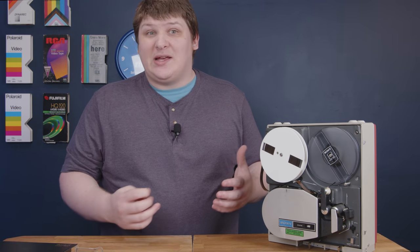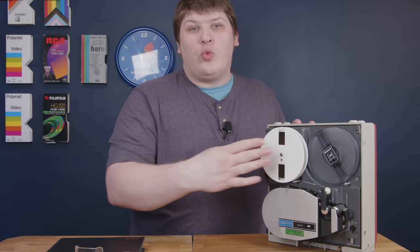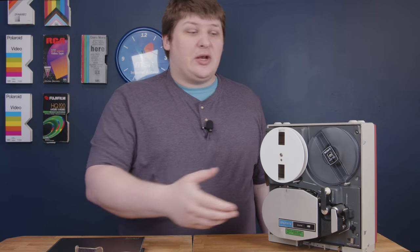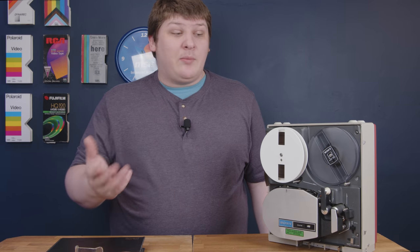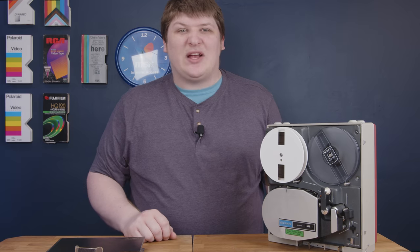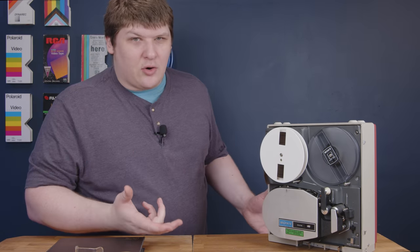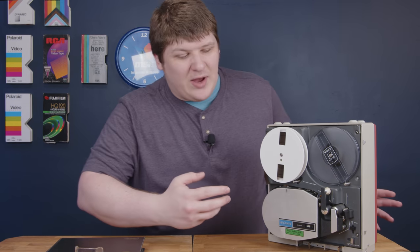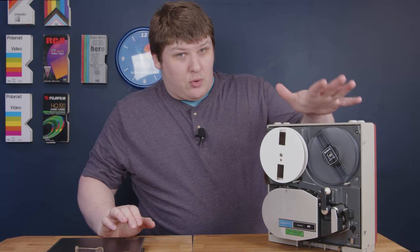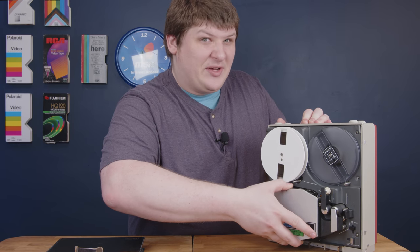This video recorder has similarities but also some really big differences. Instead of quarter-inch tape, this uses half-inch tape, which is simply twice as wide. With magnetic tape, more width usually means higher bandwidth, and that is true here, but not for the same reason it would be in an audio tape machine. The reels are almost impossible to buy now on eBay — I think people just throw them away. Fortunately, my friend Richard was able to make a 3D-printed one for me; I believe you can get the design on Thingiverse. The tape path is much more circuitous than on an audio recorder — that has to do with the actual shape of the recording mechanism itself.